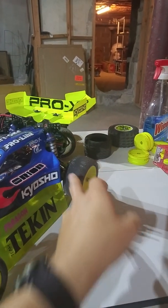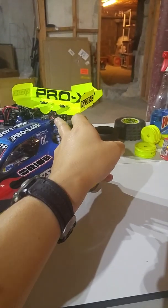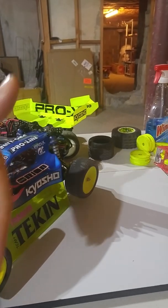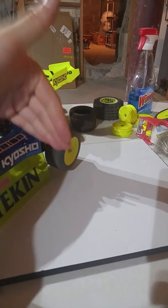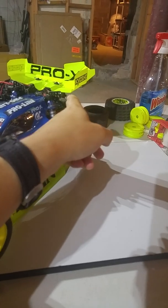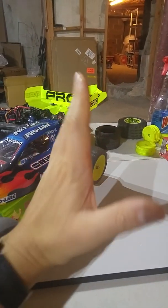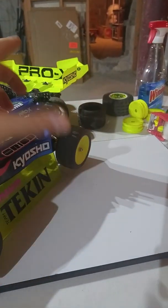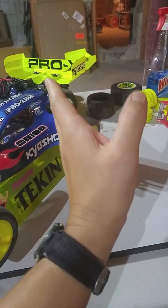The other thing you can do is to keep that bottom mounting point the same and move the top point outwards. That would also add to stiffness, but it would reduce the progressivity of the suspension. So there are 2 ways to reduce chassis slap, right? Move the top out or the bottom out, but each one will have a different effect on the shock angle. Okay, so that's something you should play around with a little bit to see whether you prefer to have that shock more vertical or more laid down.